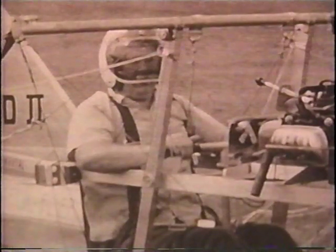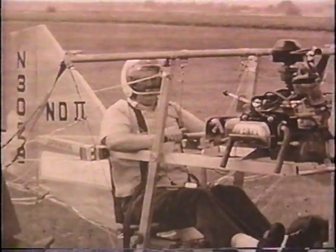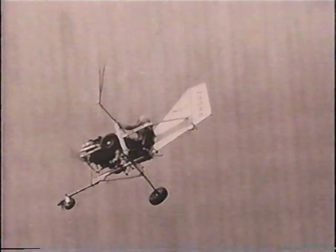This was in the 60s — no good engines available. I was building up one of the early Volkswagen engines, carving our own propeller without knowing much about propeller design for slow speed. Our propeller efficiency was poor and we were using direct drive, since reduction drives weren't available yet. That one did fly, but we calculated we were only getting about 12 horsepower at the propeller. Takeoff performance was very poor — we almost had to be towed up — but then it had enough power to keep flying. The machine had a large rudder because we thought we could turn the whole thing with rudder. But this proved that once flying, the wing is so stable that it goes where you guide it with wing warping. You can turn the cart sideways and the wing just keeps going where it's going — you have to warp the wing or pull the shroud lines to turn it.